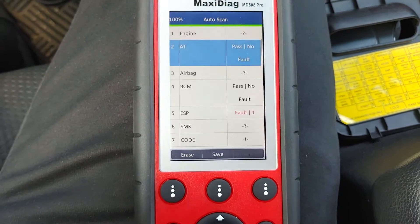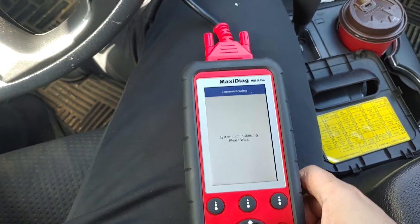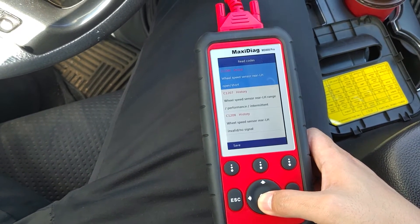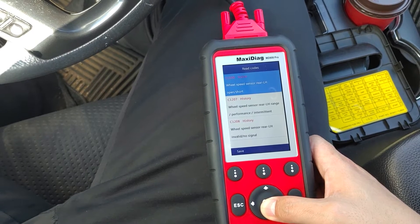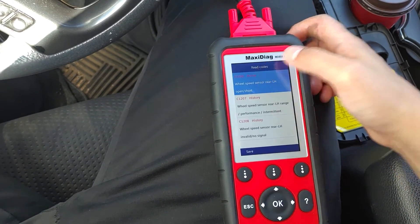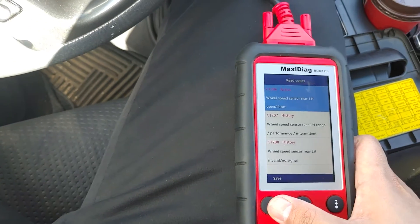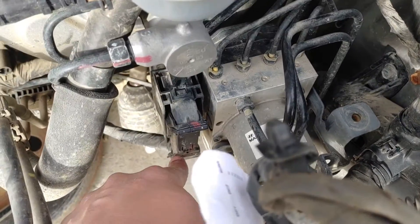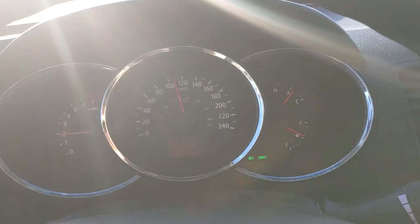So there you go — if you've got a bad ESC module causing problems with your speed sensor, now you know how to diagnose it. As far as pin 18 goes, I can only theorize that it was allowing the left front speed sensor to operate due to the short we found in the first video. Since the ESC module was at fault, it tells me there was a connection problem with the terminals inside the unit. It's possible that pin 18 shifted locations and was shorting out with another power source. This is the only explanation as to how the left front sensor wasn't showing any codes. We know that pin 19 was dead and the left rear sensor was toast as well, which is still the correct diagnosis.